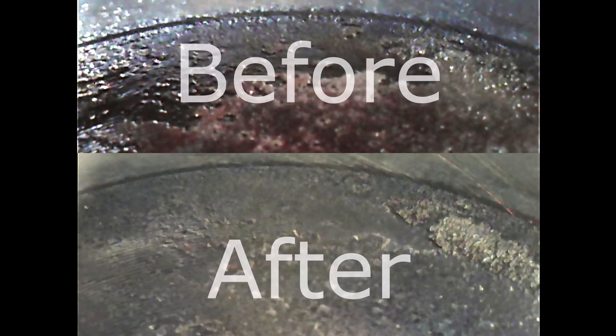Check out Cylinder 2. Looking at the before and after — that black shiny carbon from before is not there anymore. That black shiny carbon is like a wet, gummy carbon — it's soft, almost like a sludge — and you can see that carbon got cleaned off, which is pretty good. But that big clump of carbon to our right is still there, which is kind of disappointing because that's the more important stuff you want to clean off. So with Cylinder 2, Gumout does work, but it hasn't proven that it works on the large carbon deposits, which is what we want to see.